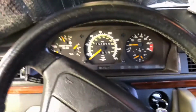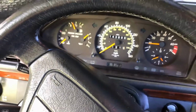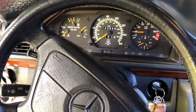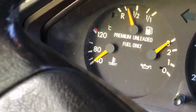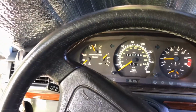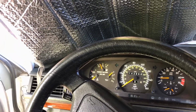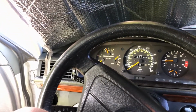Now he did say that he saw the coolant lamp lit up when he was at the drive-through. He'd shut the engine off, and then when he took off, the temperature got back down to normal, about 85 Celsius. We did take this to Starbucks drive-through the next day, and he said he saw that light flashing, the coolant light, even though there's coolant in there in the tank.